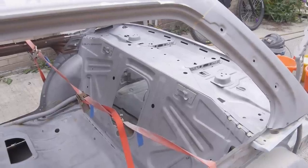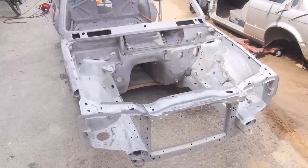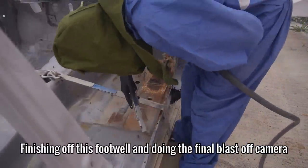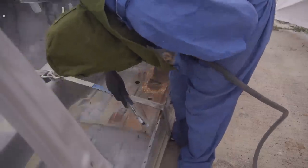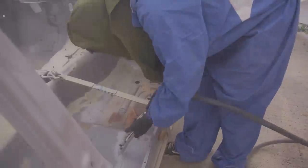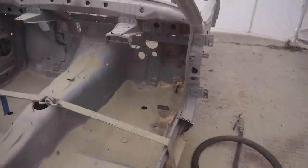With all of the media gone you can really see the difference, and doesn't it just feel great? Just a few more spots to go and it'll be ready for epoxy primer, which as I'm about to find out isn't as straightforward as it sounds. Finally on day 5 of blasting, all of the easily accessible areas are blasted and I can drag it into the spray booth and get some paint down. Well, not quite.